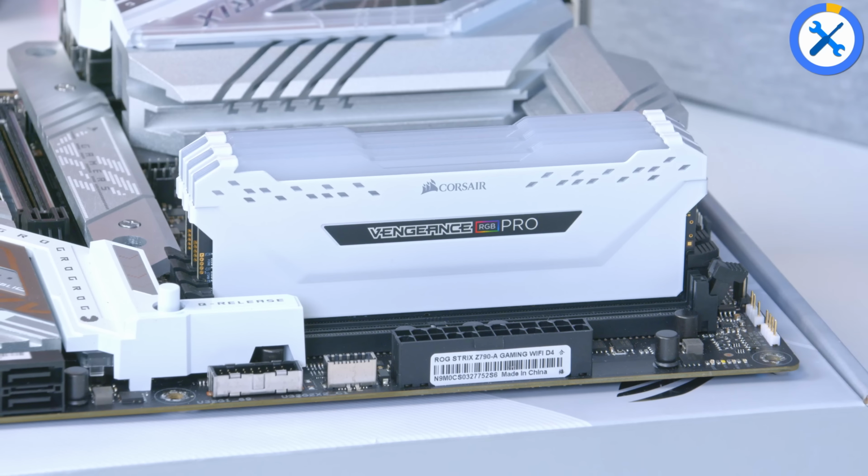While the bulk of the motherboard assembly has technically been done, I am going to do a bit of prep for the cooler. You should find one bag that says Intel HW, Intel hardware on it. That's what I'll be using and will need for this build. The first of those pieces is one of these 3 bags. Now you can see here, one's for 1150, one's for 2011, and one's for 1700. 1700 is the one we need.